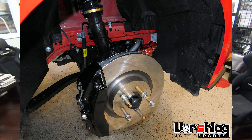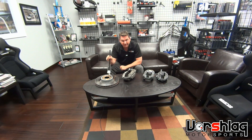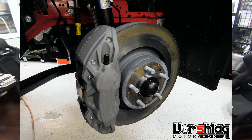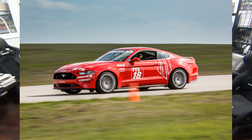The 15-inch version — an inch bigger with a six-piston caliper using about the same size pad — is a non-inverted hat. But it originally was an inverted hat design. This engineer said the inverted hat on the 15-inch didn't work either. They did track testing with horrible results, and he had to gather actual temperature and track data to convince management to let him design a regular non-inverted rotor for the 15-inch. It was done at the very last minute — a close call. The performance-pack cars could have been a complete flop on track. Maybe the green-group HPDE guys cruising around at 50% can get by, but if you're even semi-serious, this is going to leave you off in the weeds.